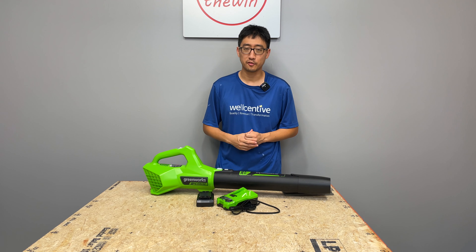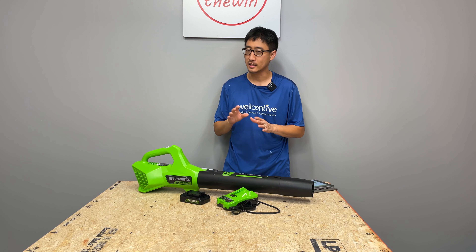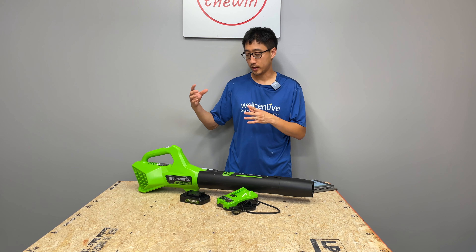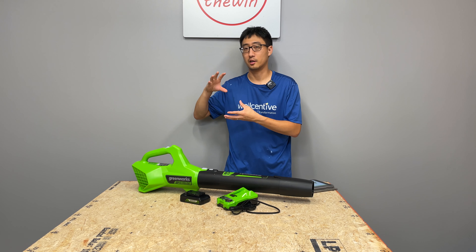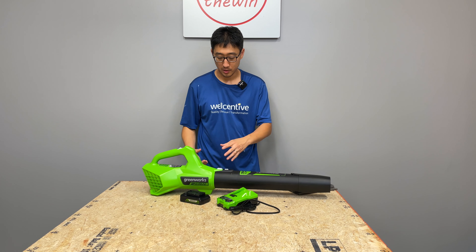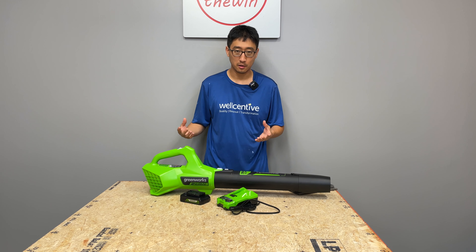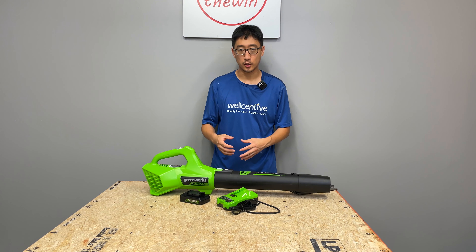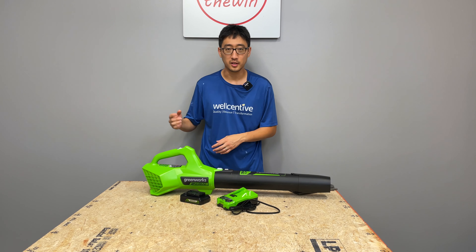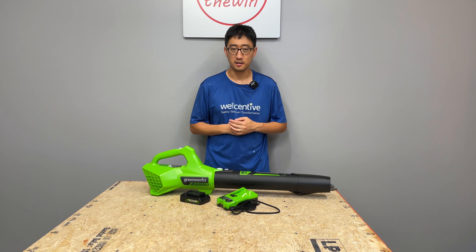Just because you're in the 24-volt platform doesn't mean the tools are bad. When it comes to blowers, there are mainly two types of fan styles: the centrifugal type and the axial type. This one is the axial type — the propeller blade turbine is parallel to the incoming air. The main benefit of an axial style blower is it moves more quantities of air more easily, but the downside is it can't do so at high pressure. A lot of blowers on the market are axial style because it's generally more efficient and draws a little less energy.